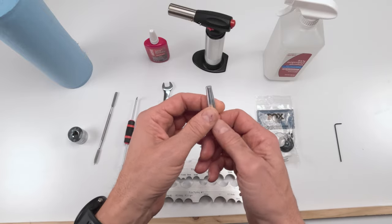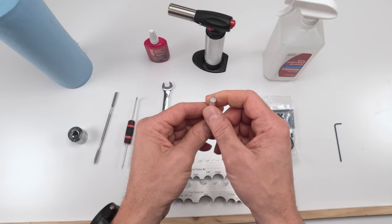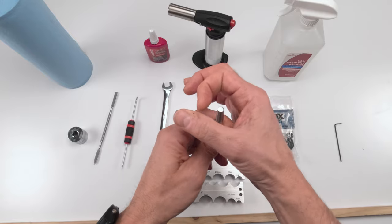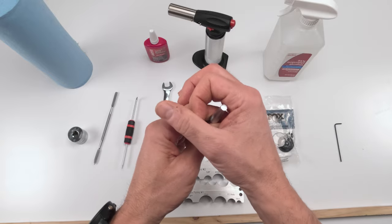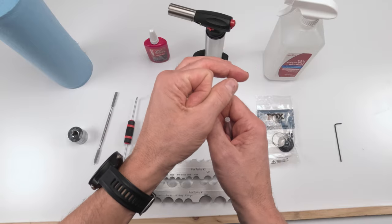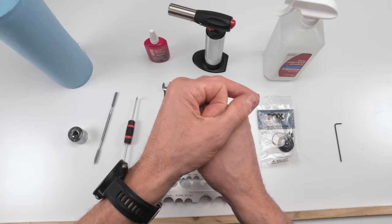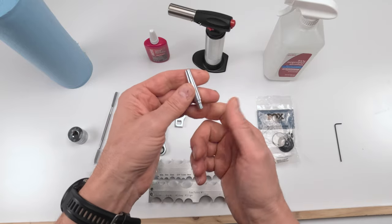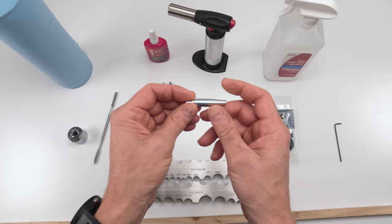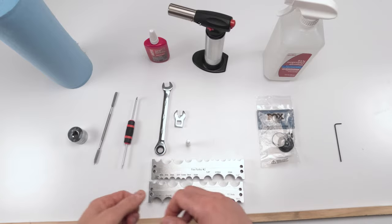Now, technically, you don't need it, but I would say that you really sort of do need it in the sense that it's so much safer inserting the piston. The air piston inside has a quad ring, and those things have sharp edges, and the shaft that it goes into has sharp edges, and you take high risk in actually tearing that seal that we're going to change. And you don't want to do that, basically, right after all that work. So these little bullet tools, they come in very, very handy. All right, I'll put the part number in the description section.